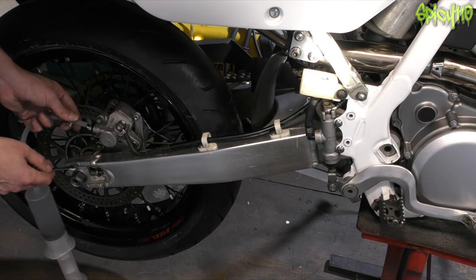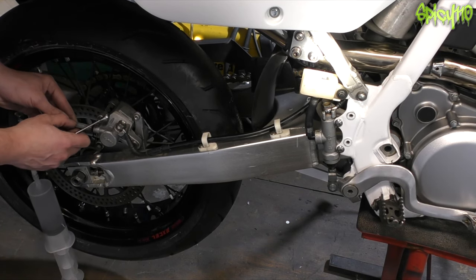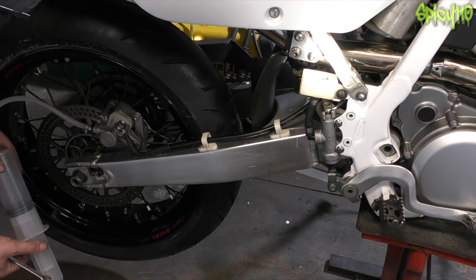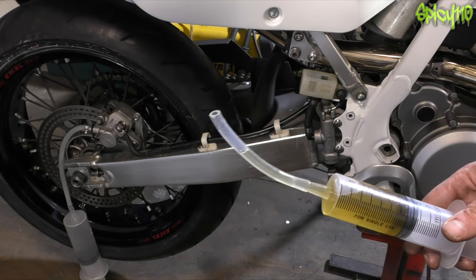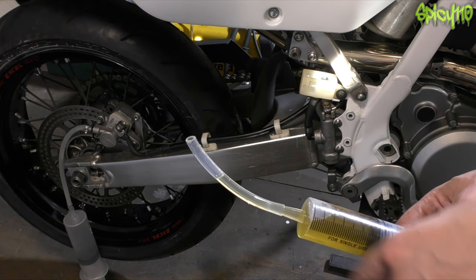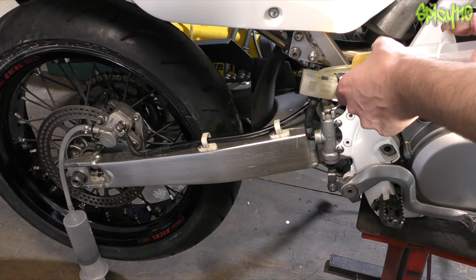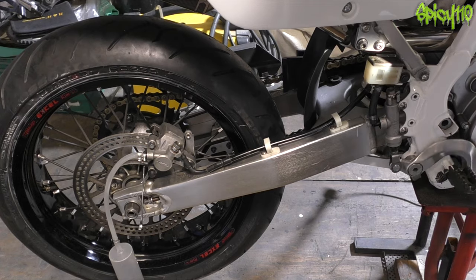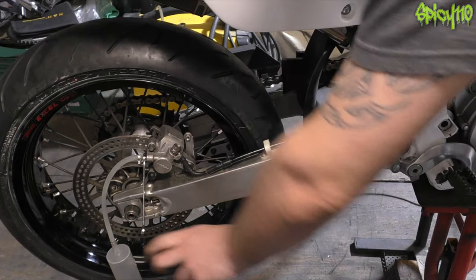So I'm going to do this the traditional way. This is a syringe, but I'm not reverse bleeding it — I'm just going to use this to basically collect the fluid. And I'm going to use a syringe with a hose on it to help fill this and not spill any. I've got these on my Amazon storefront — if you go to the links in the description, it says products I use, and this is one of them. And this is the classic game of pump, pump, pump, pump — press and hold, release the pressure, put the nipple back on to seal it, and repeat.